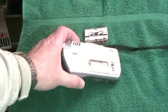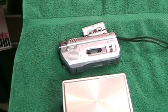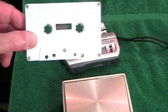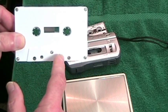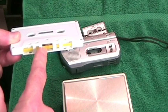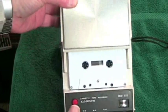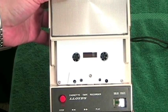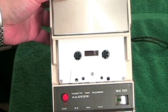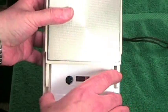That's very good for the convenience of portability, and machines like this Sony could be slipped in your pocket and carried around. Obviously you could not do that with something the size of a standard cassette unless you had really big pockets. A standard cassette always feeds with the full reel on the left and the take-up reel on the right, the capstan on this side and the heads in the center.